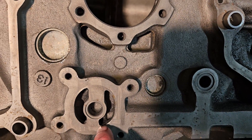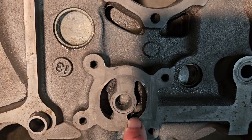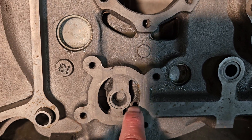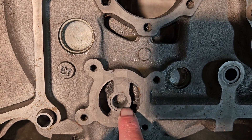And in which case you can also optimize oil pressure flow. If you look in your pump here, you can see that the drilled passage connects with casting that can be radiused and smoothed out. You don't want to damage your land, and you've got some pretty fine tolerances.